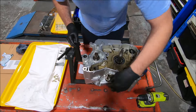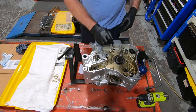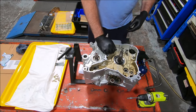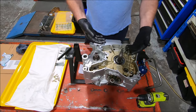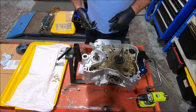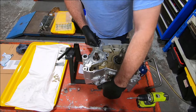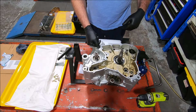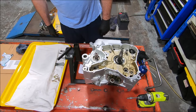There we go — rods are in the right place. Look in the middle. I did assemble an ST2 a while ago and for some reason, after I put the cases together, I decided to put the cylinders on. Usually I'd build the sides up first — which was lucky — because when I went to put a cylinder on, I realised the rod was off to the wrong side because I had the rods in the wrong spot. It was just lucky.